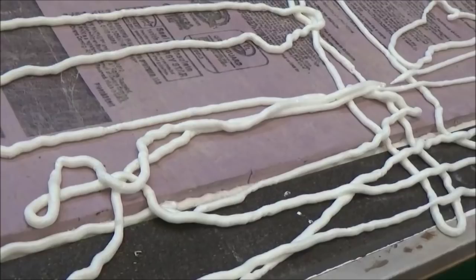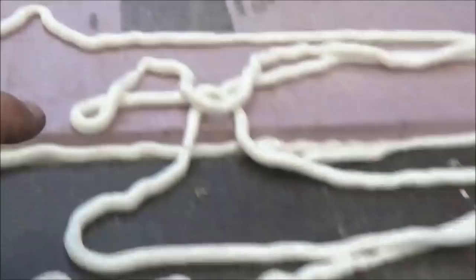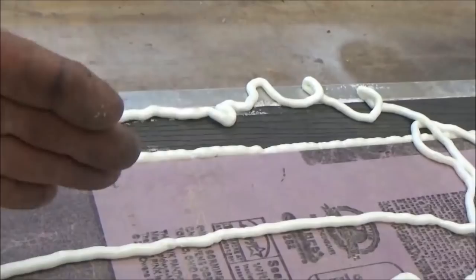So what we did, this is a piece of composite, which is screwed in. We screwed it in there, and then I got another piece there for the top. That'll get all of the backers and the strong backs we need to screw in the cabinets. And then we put some foam inside here. It was deliberately cut short so we could load it, because that's what's going to help it bond. It's going to be all glued together. So that's what we're doing now.